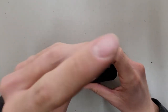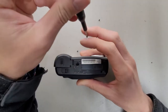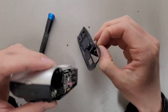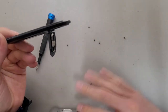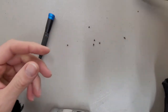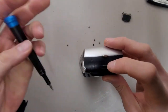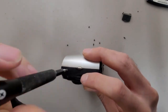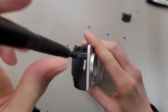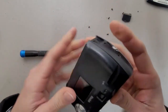I should find a screwdriver with a non-conductive handle so I can discharge the capacitor. But I'm going to hope that my confidence isn't misplaced, and that since this thing hasn't been plugged in for who knows how long, the capacitor has been drained. I'm already having flashbacks of getting shocked by the flash. Let's hope I don't regret making this video.